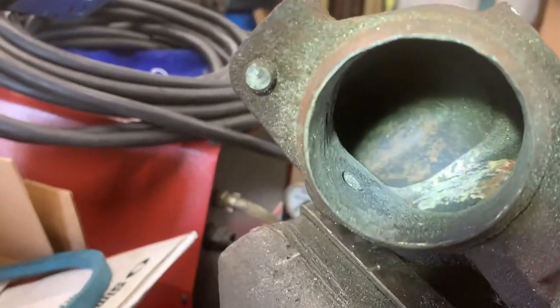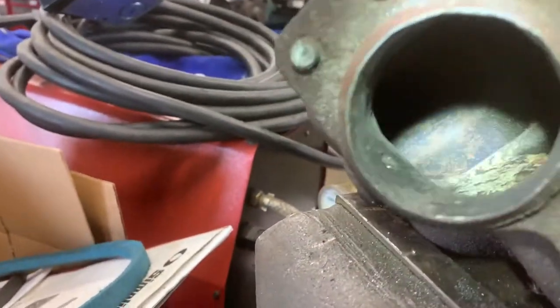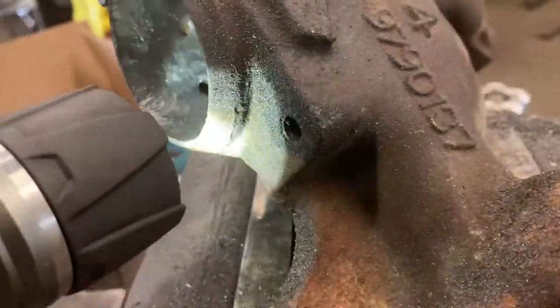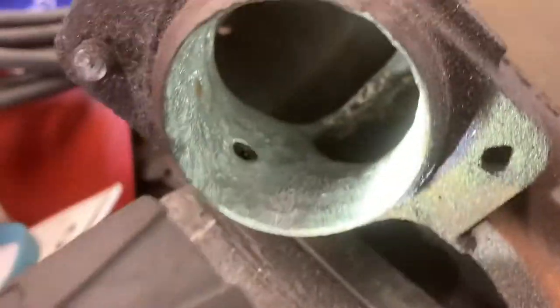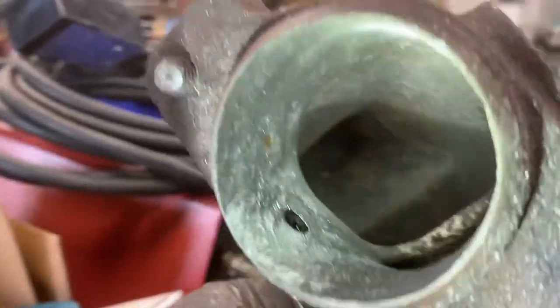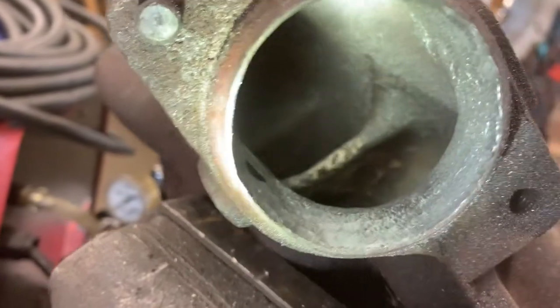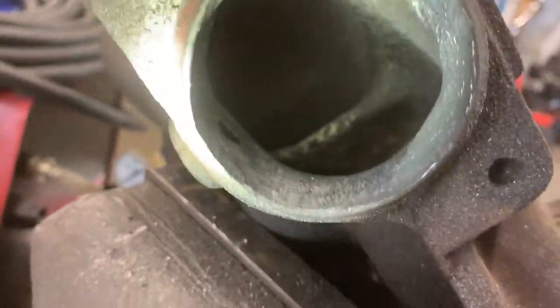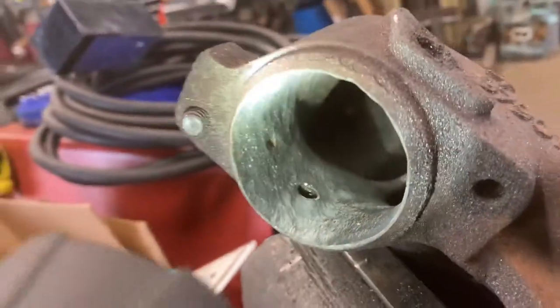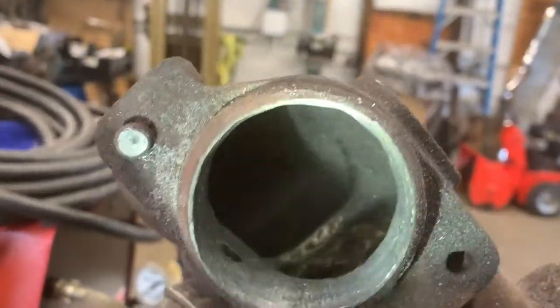The first outlet is done. I basically took the whole sharp edge off it and smoothed everything out, definitely increasing the size of the inside of the opening. When you've got a big boss like this — this is a ton of steel right here, very thick — you can grind the crap out of it. Whereas on the other side you can't do as much because you're going to blow through, and welding cast iron is a pain in the ass. I took an easy eighth to three-sixteenths inch off all around the circumference. I don't open up the ID at the very end much because you want the exhaust pipe to seal to it. But compared to the old shots, they took a ton out — it's got to help the flow.